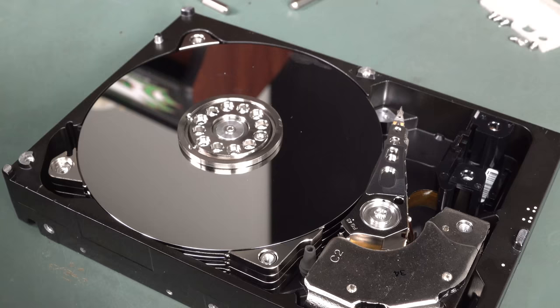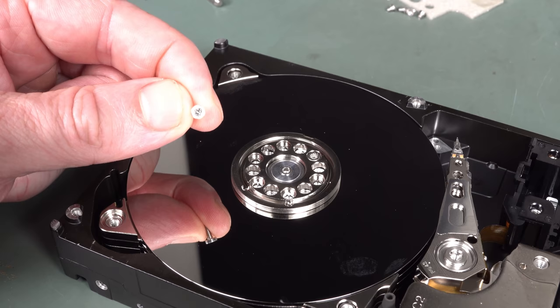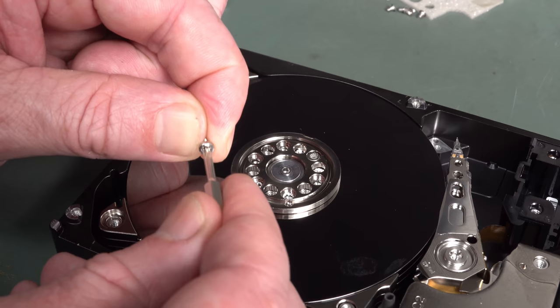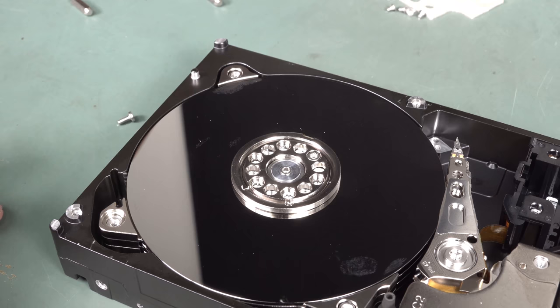Now, unfortunately, the final screw in there seems to be stripping. What I've done is looked at this screw under the microscope, and a T7 fits and feels fantastic, though there is actually a tiny bit of play in it. A T8 doesn't fit. So it's almost as if there's a T7.5 or something. Is there an Imperial size? I don't know, I've never encountered that. But I cannot get that bloody last screw out.